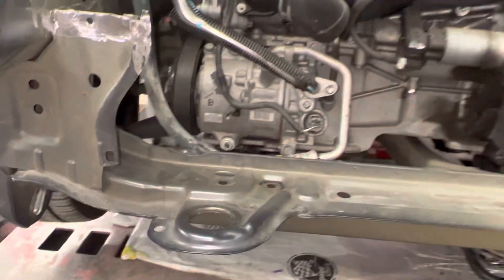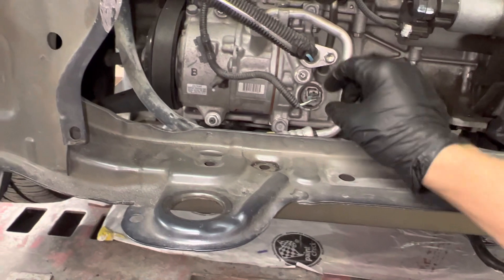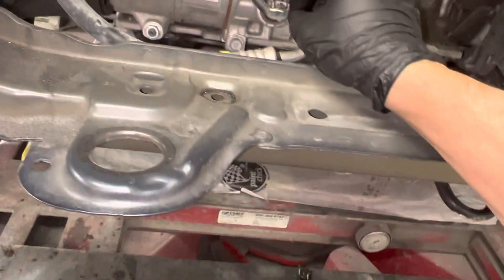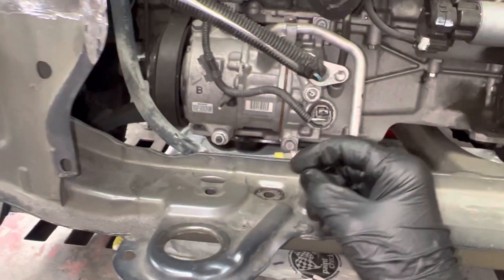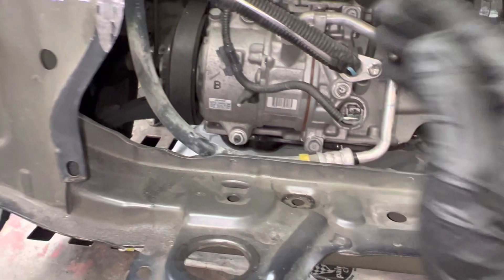You can use your scan tool if you have the right one — you can drive this and measure it. It's only a duty cycle voltage measurement out here, so you can test it with an oscilloscope or a duty cycle count reader. You can drive the valve and read it on your pressure gauges or transducers in the car to tell whether the compressor is functioning. That is the electric compressor control valve — that's the generic name for it.